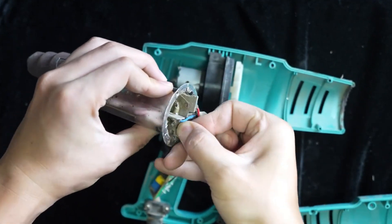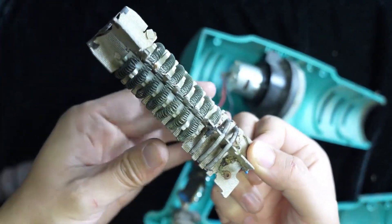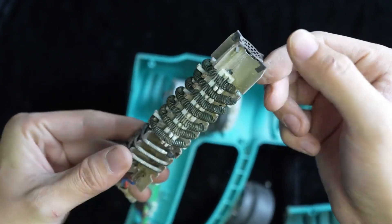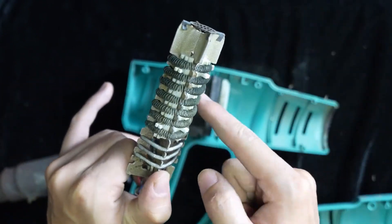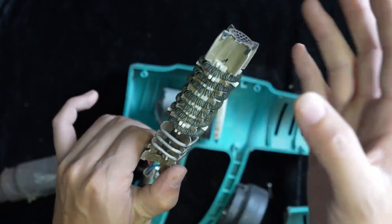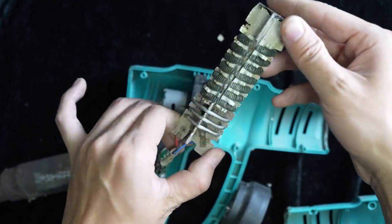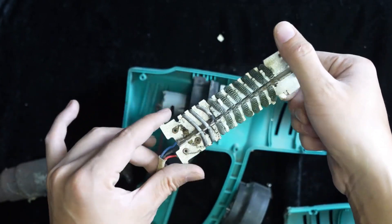Let's turn it on now and take it down. Look at this place — it's exactly the same as the old heating elements used inside radiators and water stoves. The electric stove wire here, after electricity is turned on, will burn red, and then wind blown through it becomes hot. That's the simple principle. If it doesn't heat up, it means the wire is broken. The only fix is to replace it — let's go buy one. I spent 18 yuan online to buy this replacement part.